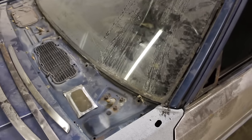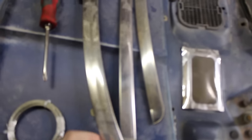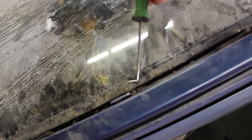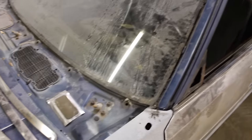The first thing I did on the outside of the car — I got a little bored last night, came downstairs, and took all of the trim off around the windshield, all of the stainless. It's really easy to take off. I have a little 90-degree pick tool. You shove it down in the side where these little plastic clips are, pull back on those clips, and it'll release the edge of the trim. Whenever you're ready to put the trim back on, it literally just pushes down and snaps into place.